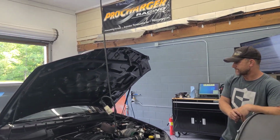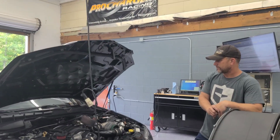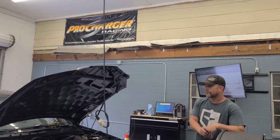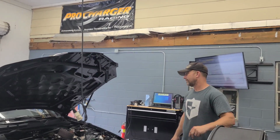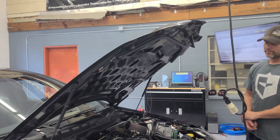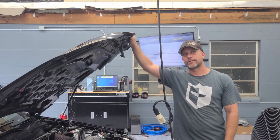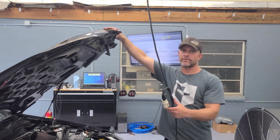I'm going to go do a very quick jaunt on the street, literally just to check AFRs to probably 5,000, 5,500, and lower his rev limiter and send him. Because I don't want this thing turning 7,300, 7,400 RPM at this air fuel. Or just get into the edge. Sure. We had 70%, 67% ethanol? Oh, yeah. About 67. So some good stuff. It's going to tap the rest of the fuel system.